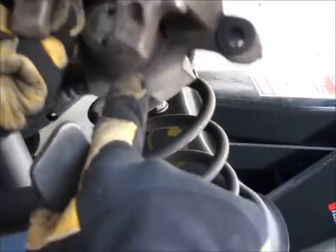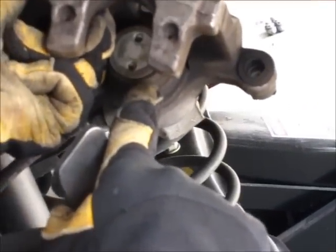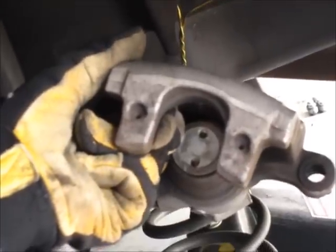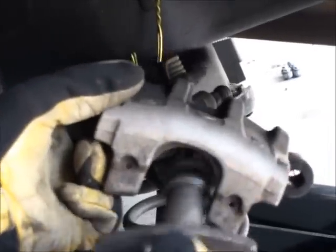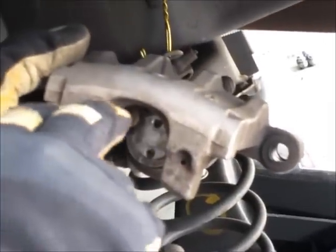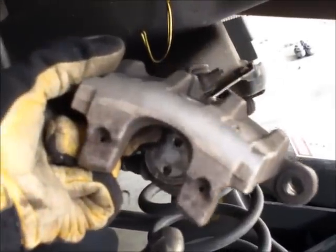I'm going to put a little bit of lubricant on the gasket here so that it doesn't get pinched or torqued — just a little synthetic lubricant on that. Then we'll set up the tool. Basically the tool's two pins line up with those two holes, this back plate presses up against here and applies force, and it's going to turn as you turn this handle. We'll be right back in a moment.